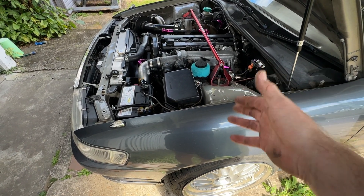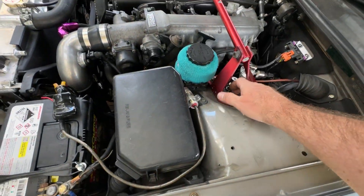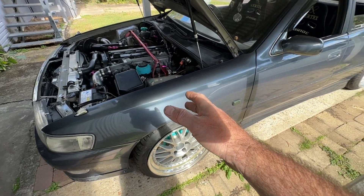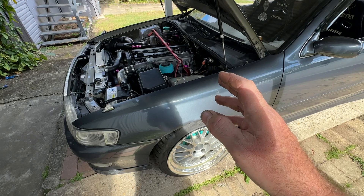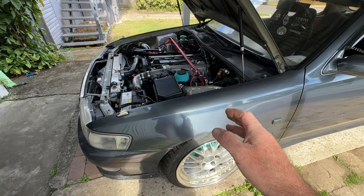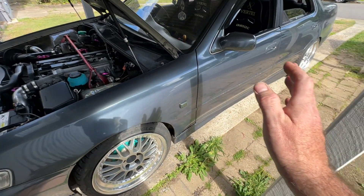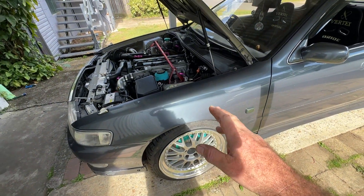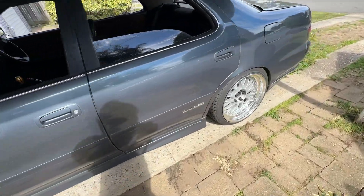K-Office is Keiichi Tsuchiya — the Drift King — his old company was K-Office, his new company is DG5. I'm running 24 kilo front springs and 6 kilo rear. Because of the extended LCAs, that's why I went 24 — if you had normal LCAs you could probably get away with 22 or 20 kilo springs. It's an amazing setup; the car doesn't feel too stiff in the front and soft in the back — it actually feels quite good.